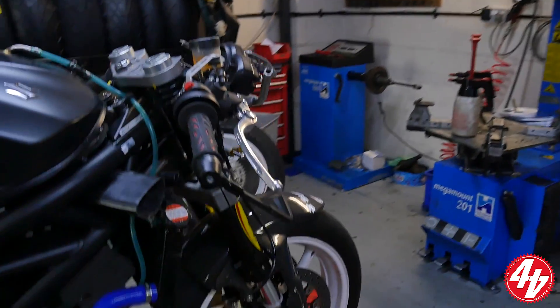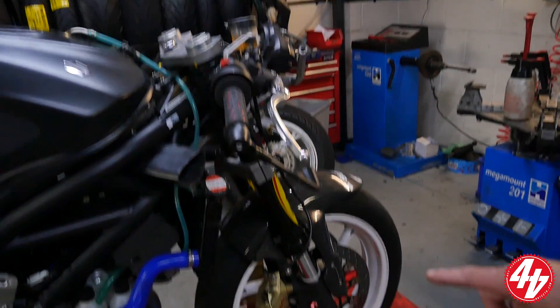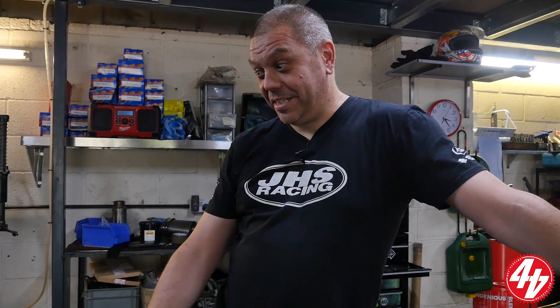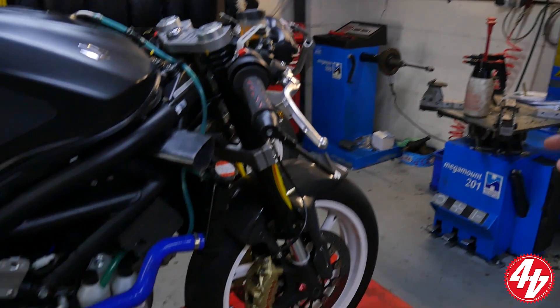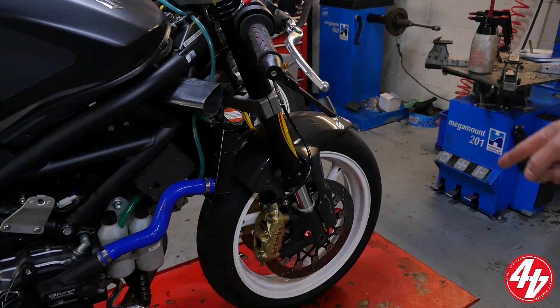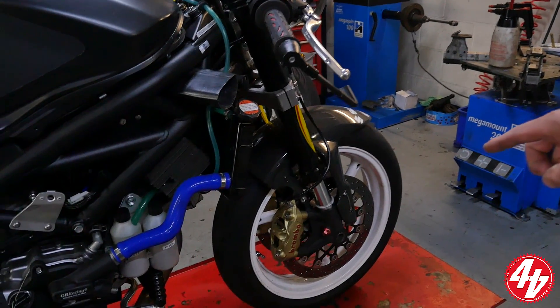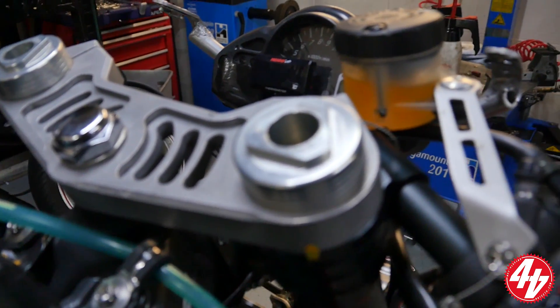Front to back, we've got GSXR 600 wheels in at the moment — though these wheels won't be in it when you race. We're having DIMAGs for the wheels. So these are just the placeholder wheels we've got on now. GSXR 600 forks with GSXR 1000 M4 calipers, and inside the forks we have a KTEC 25mm IDS cartridge kit with extender caps, and our billet aluminium yokes.